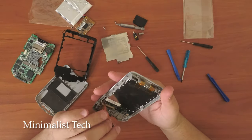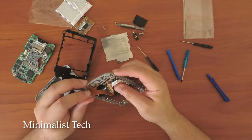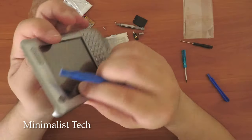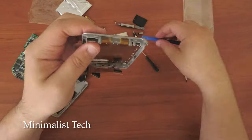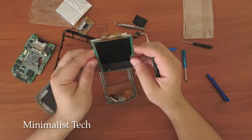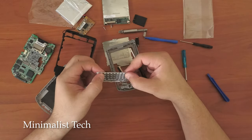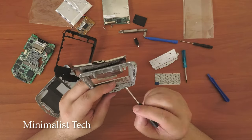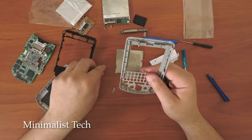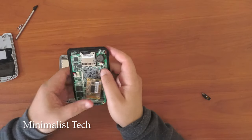So I imagine if you have any issues with the keyboard malfunctioning, the buttons malfunctioning, or you need to replace the screen itself, you can see the tape on the top of the screen. There are two yellow pieces — just the connectors that connect the screen to the motherboard. Removing the tape and applying a little bit of pressure, the display will come right out. It's actually a phenomenal display — I think it's one of the best displays on a Palm device. There are the keys and the buttons. There are two tiny little squishy pieces that need to be there, so be aware of that.